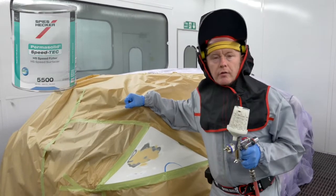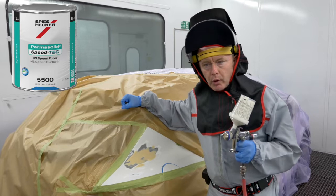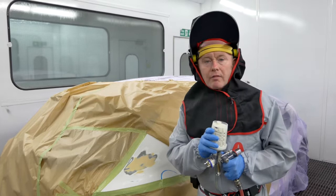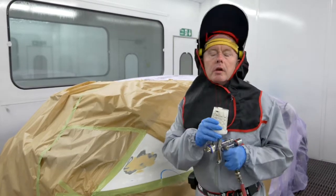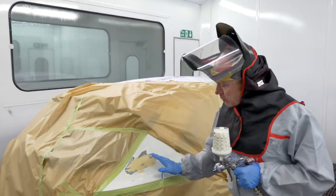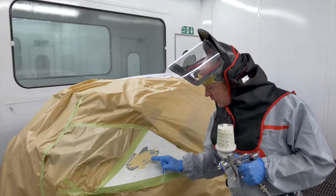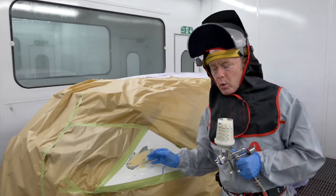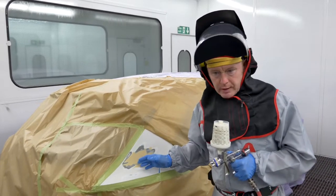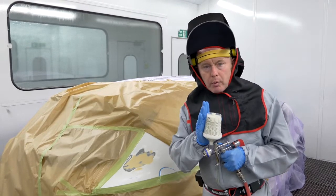Using this product is totally different to any filler or surfacer you might have used in the past. Normally a high build product is applied in single coats with an intermediate flash in between. With this however I can apply four coats without any flash whatsoever. Looking at this job with a polyester repair, I would normally spray one coat just to isolate the polyester itself, seal off any pores, and then depending on the film build I need, spray two to three further coats wet on wet. I'm using a 1.6 gun and dropping the pressure to one bar.